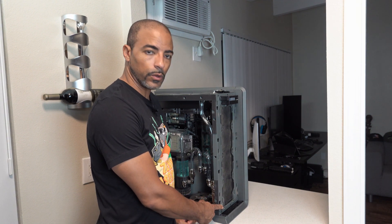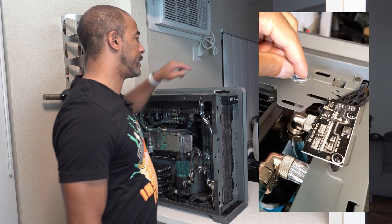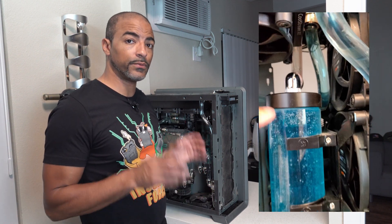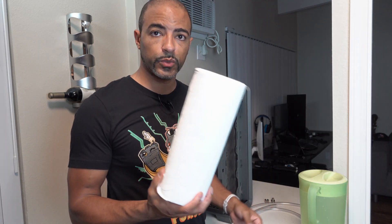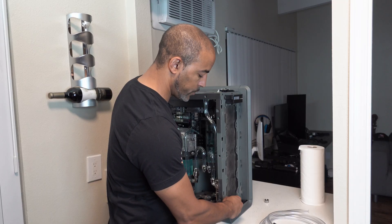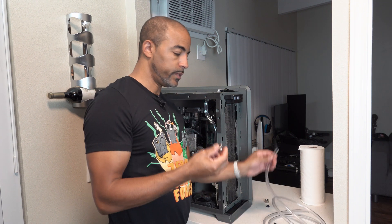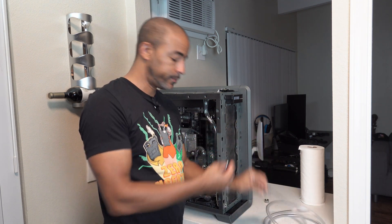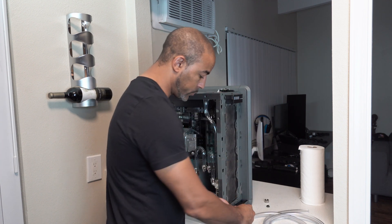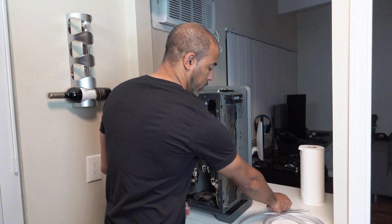This right here is gold — it actually has a drain port right here and a fill port right up top. This is what makes water cooling so simple sometimes, if you do your correct planning. Have some paper towels readily available, of course your bucket, then unscrew the cap for the drain port, attach the fitting to the tubing, screw it in, and make it snug with a little tool — just enough so I know it's not going to leak.